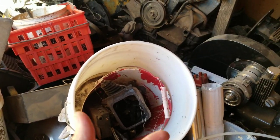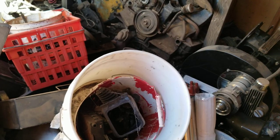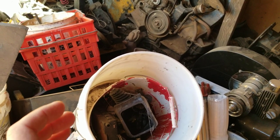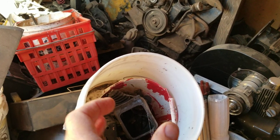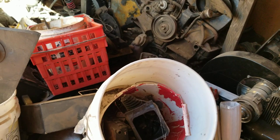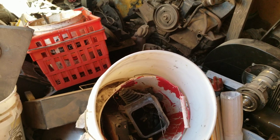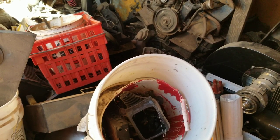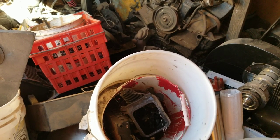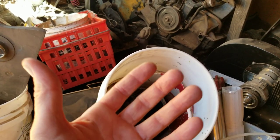You look up type 3 cylinder tin, and you'll find the ones that go underneath the cylinders that have the metered holes in them. It diverts the air. It actually meters the air going through the cylinders and allows the proper amount to go around the cylinders so that more air can go through the heads. The whole idea of that makes complete sense. It's on Porsches, they're on airplanes. People say, oh, it's because of the direction of the air. It's just more efficient. It's just a better way to keep the air managed.